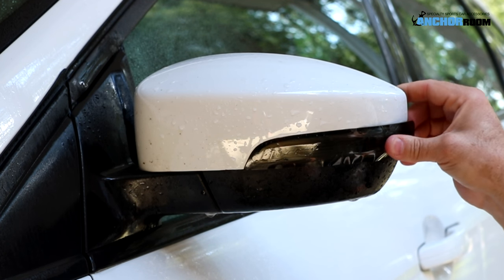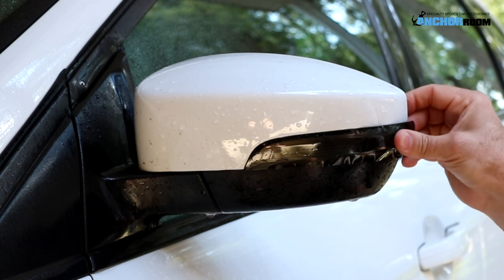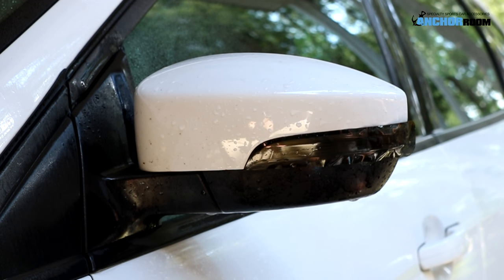For the majority of this piece you're definitely going to use heat to contour the tint piece to the lens, so we're going to turn on our heat gun. We're probably just going to use a felt tip squeegee for the tucking underneath, and a microfiber towel to make sure that we dab up any excess liquid and form the tint piece to the lens.